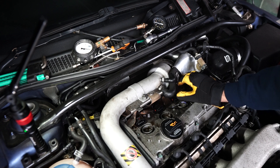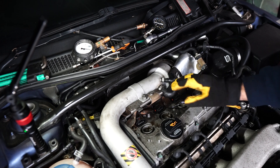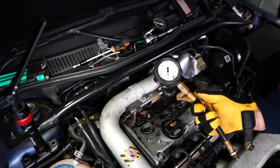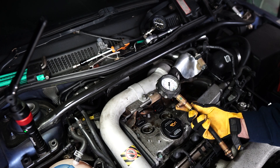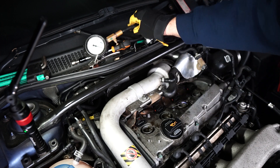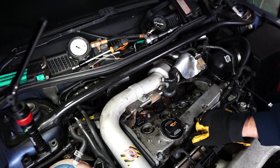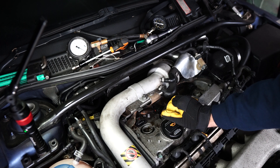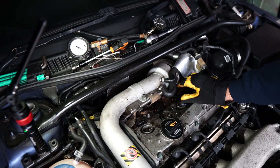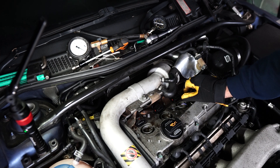We definitely need to give this a bit of a cleanup — I might even paint the rocker cover while it's off, and maybe the charge pipe as well. But to be honest I just want to get this up and running, enjoy it and use it, and then we can start looking at a big turbo swap at some point. I hope you found the compression test interesting. It's a really easy process — just take a spark plug out, wind the tester down tight, make sure injectors and coil packs are unplugged, and give it five to ten turns over. We're good to carry on with the build — until the next video, bye for now!